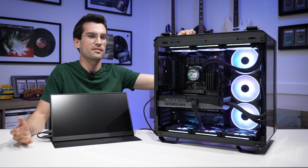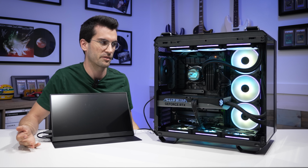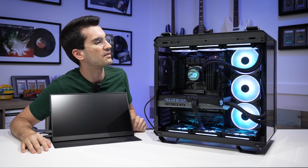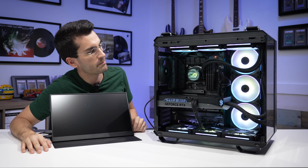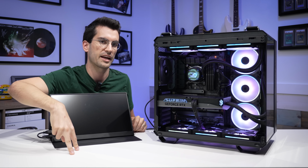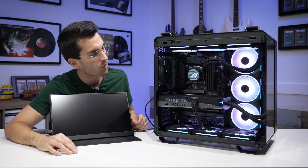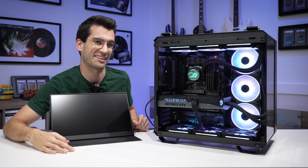And since he stated that he was able to get into the BIOS with only one stick connected and one random slot, he doesn't recall which, it's likely we either have an issue with the 14900K communicating with the memory, so maybe a dead memory controller or a failing one, or we have one or more bad sticks of RAM.